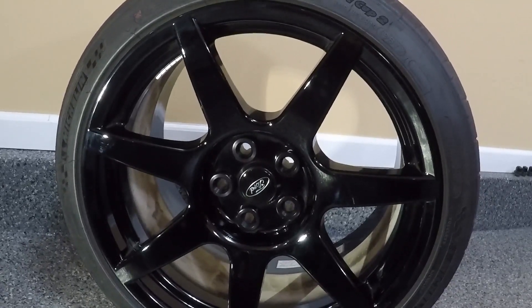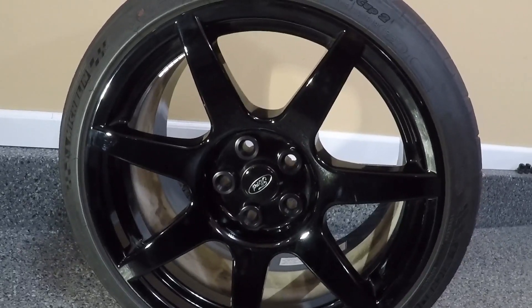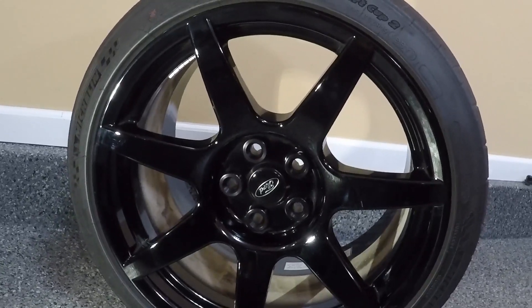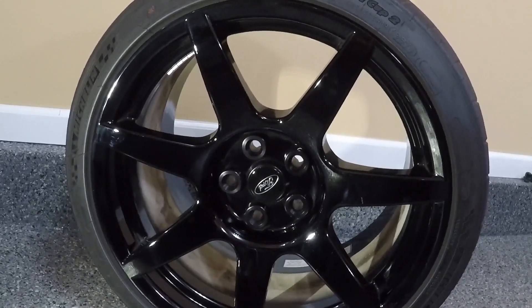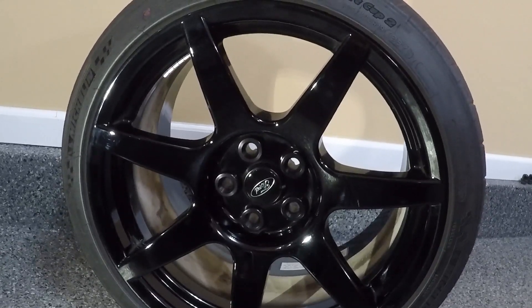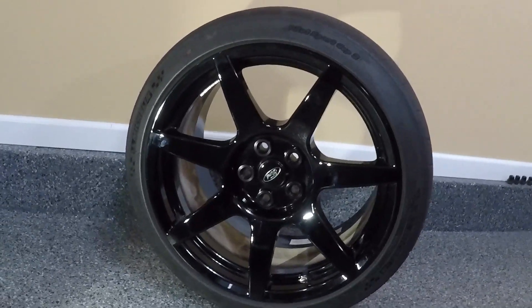So it's a pretty big wheel with a very low profile and wide tire. The front wheels are 11 inches wide, and the back wheels are 11.5 inches. These are very lightweight compared to the standard GT350 wheels — these are about 18 pounds, whereas the aluminum equivalents are about 33 pounds. So you're saving about 15 pounds of unsprung wheel weight on each corner.